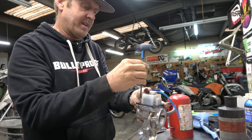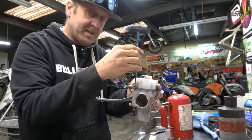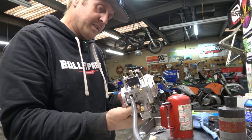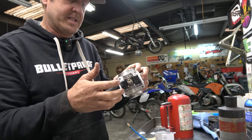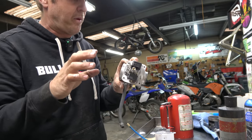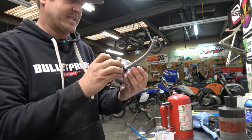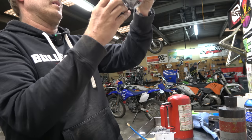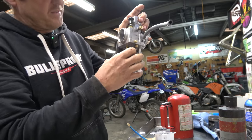As I was riding you could see dirt building up around the gasket. I did check the float level, but because it's clear you can check it from the outside, which is kind of nice. I never had this bottom plate off. Everything looks legit — it's got their name on the float, name on everything. I thought about raising the float level, having the fuel shut off earlier, but with how lean it was running I don't want that. I don't know what these two things are — they seem to be internal venting with little check valves. Maybe those aren't working.